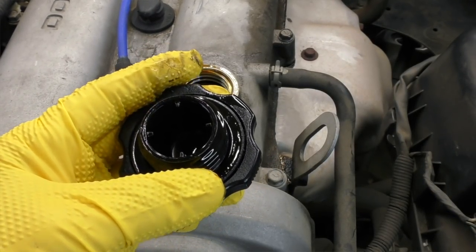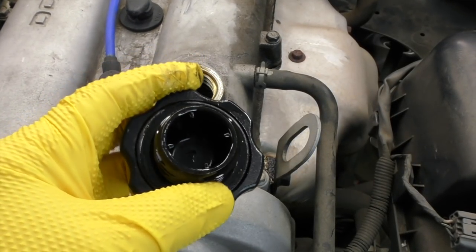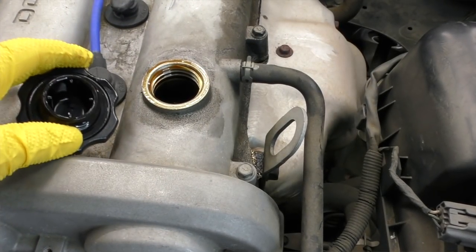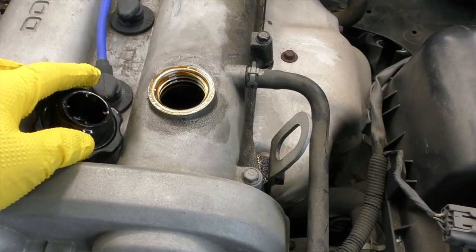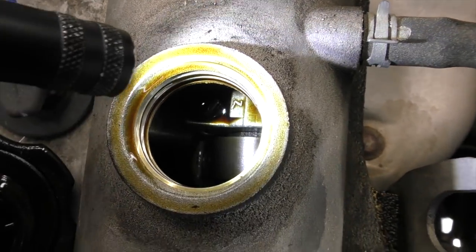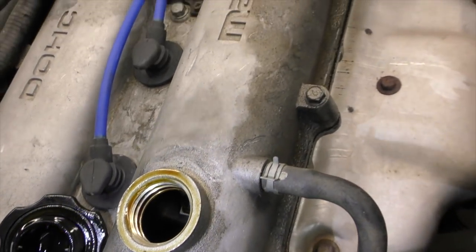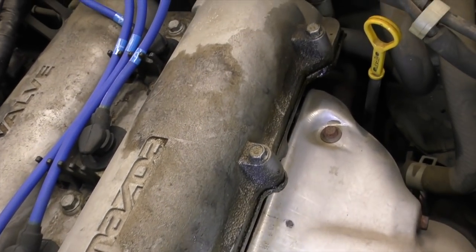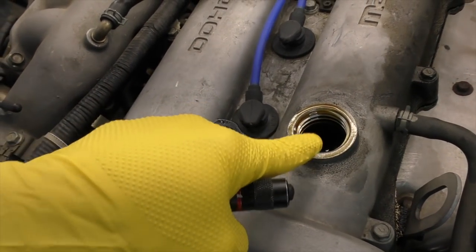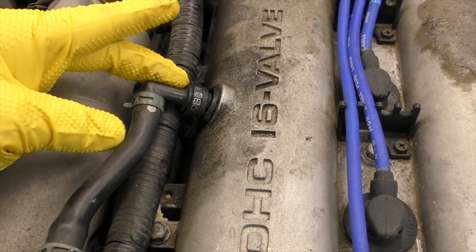You might also see a white gooey material on the oil cap — this is a sign of moisture buildup inside the engine. It could be due to something as simple as too many short trips and the engine never fully getting up to temperature, or it could be something much worse like a blown head gasket. If you see that moisture buildup, don't panic, but do some extra inspections. Everything looks pretty darn clean in here, which I'm super happy about. I am noticing some oil leaking around the valve cover, so we'll be pulling the valve cover off anyway.